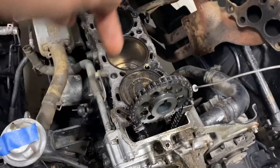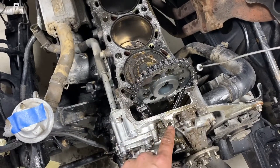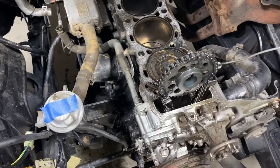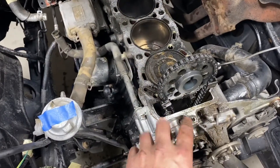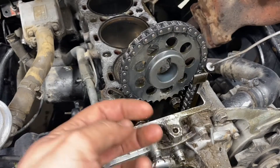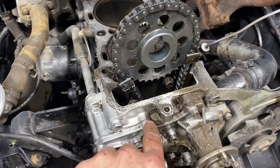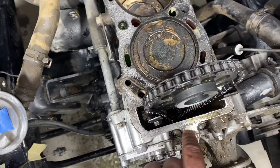Here's what I think happened. There are 10 head bolts that hold the head to the block, and there is one bolt that's typically hidden that basically bolts the head to the timing cover right here. Oil will kind of pool up over the head bolt and you won't see it. I suspect somebody was trying to remove either the timing cover or the head — they didn't know that bolt was connected. You've got to remove the valve cover to get to it. So I think they were prying and actually cracked it. You can see a hairline crack right below those teeth — the bottom three or four teeth are pointing right towards it. Oil is working its way through there. Someone knew this and tried to fix it with JB Weld, which is totally the wrong thing to do. It doesn't need a new block — it just needs a new timing cover.